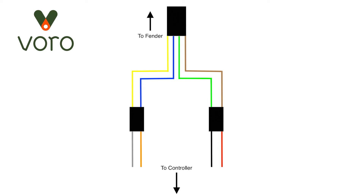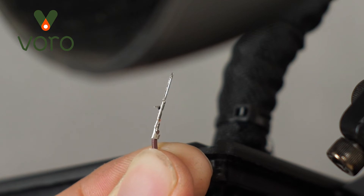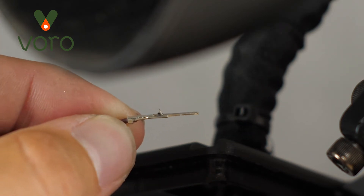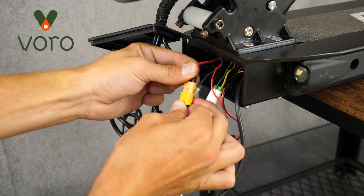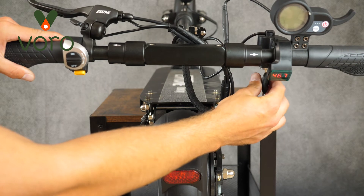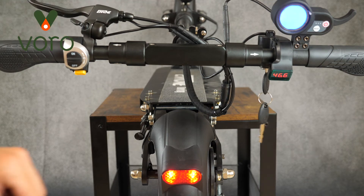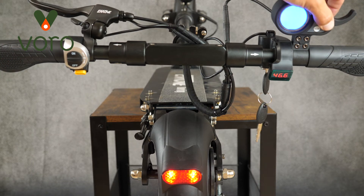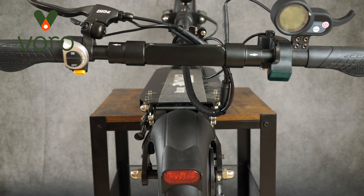If you find yourself having to redo this step, use the same tweezers and the same method as before to remove the wires. But once you've removed the wires, go ahead and bend that metal tab up so that they will lock in the connector when you reinstall them. Now go ahead and reconnect your power — the connectors are yellow and each has a black wire and a red wire coming from them. Just slide them together. Now you can see the red light glow on the fender. Everything looks good, so we're going to turn it off and continue on. If you find that the light does not work, go ahead and retrace your steps to make sure you didn't miss anything.